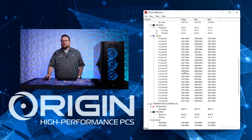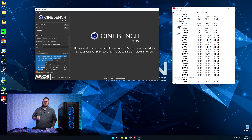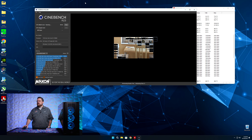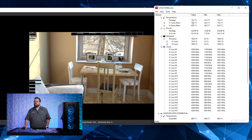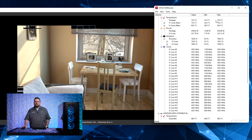What you're going to do is open up Cinebench, which you have downloaded. I'm going to run Cinebench for about 15 minutes — basically soak your CPU and your cooling to know where you're going to be at thermal max. You can see right here we're going to start looking at these temperatures. We're going to sit around 75 and see where this max number is at the end of 15 minutes.